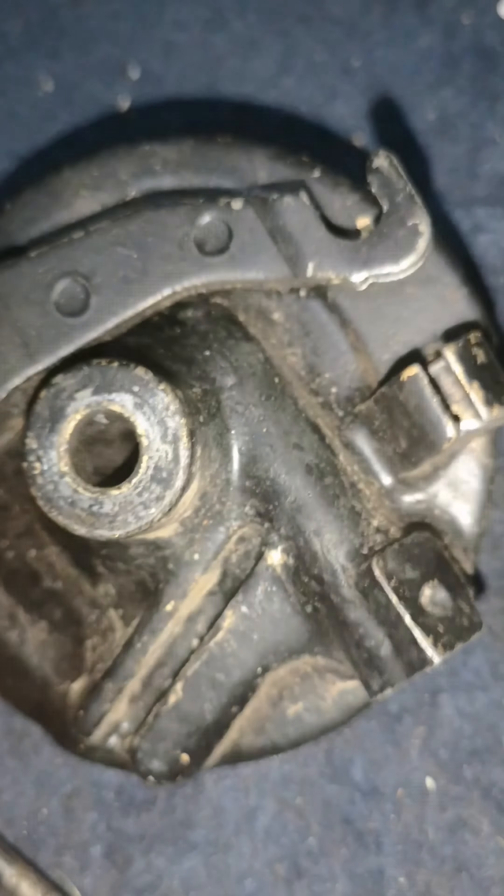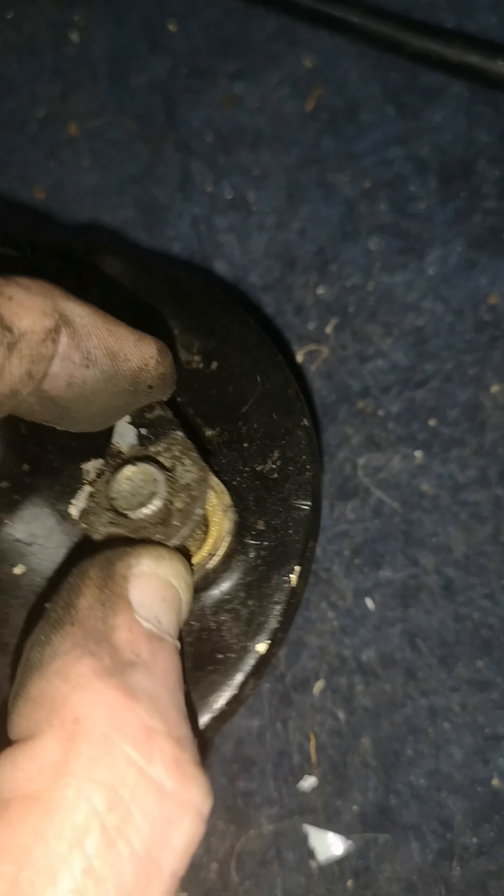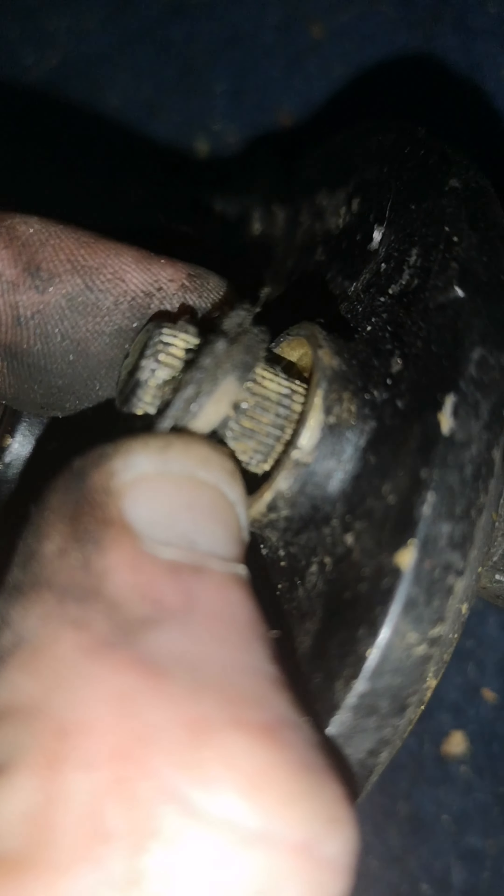Let the brake arm off - the ball's down there, I'll find the nut and put it back in. That was behind it so I just thought I'd put this in the video. Let's see if there's anything else on it - it's like some sort of washer or spacer. Looks like it's got a plastic seal on it, it's got a sponge seal, and that's the little washer off. I'll look closely to see a pointer. That spongy thing was in there - I'll check what goes in there, see if it's a gasket. There's a pointer there, so maybe it's that. When it goes on, them two pointers line up like that.